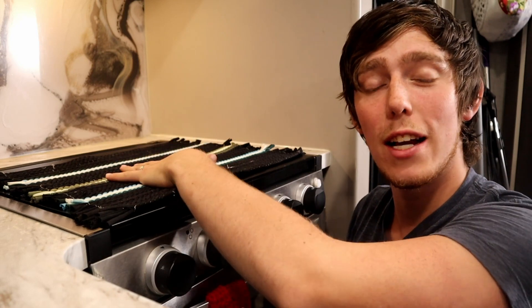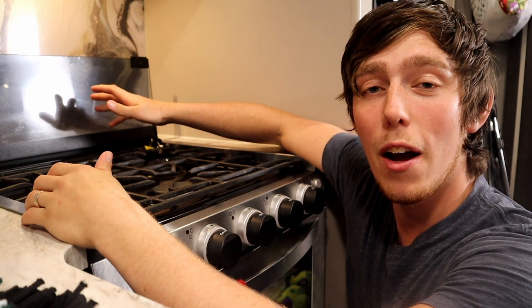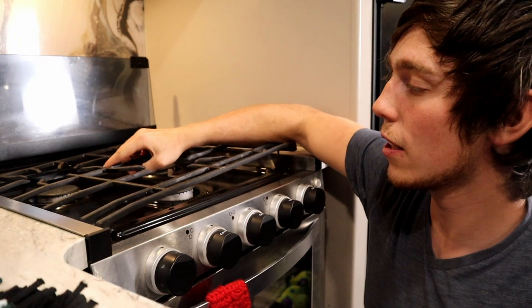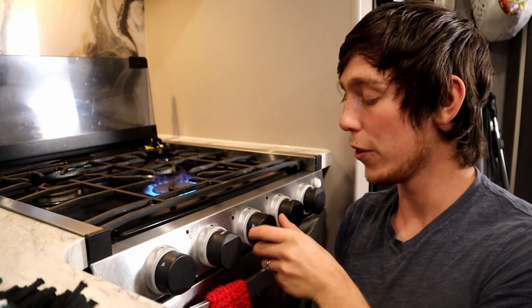Now let's move on to the stove top. There's a glass covering over the burners — we keep a cloth on top to protect the glass from cats and anything that falls on it. Most glass coverings are bi- or tri-fold, so they fold over and flip up, also acting as a backsplash to keep grease off the walls. Most stoves have a removable metal section that holds pots and pans, and most have three burners. To turn on a burner, press in and start to turn until you hear the propane, then click the starter — and you've got fire.